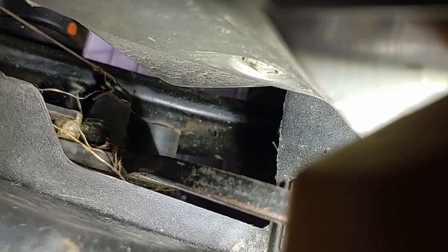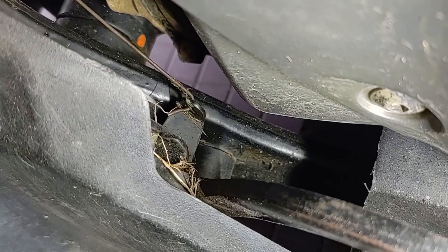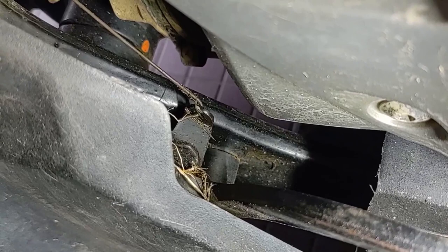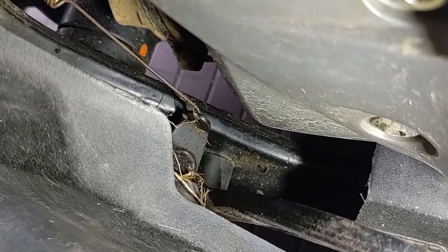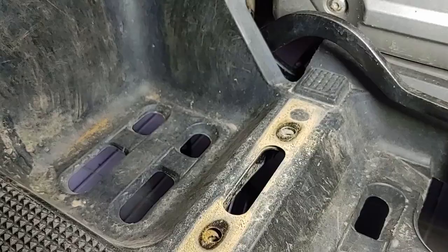I'm having a hard time getting light in there. I don't know if there's a bushing in there or what's going on — hoping to get a look at it. I've done a little bit of checking and experimenting with the cable return spring and everything seems to be okay. I'm going after this pivot point because I think it's the culprit. I'm going to get this off and at the very least clean and lubricate it. If that doesn't fix it, I'll know it's something else. I've already got a new rear brake cable for this, but I'm hoping to keep it in the box.